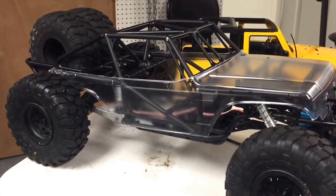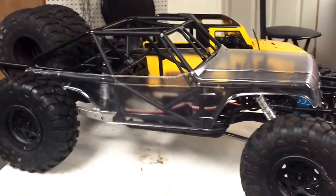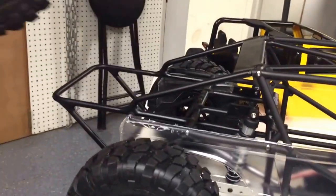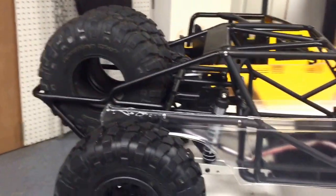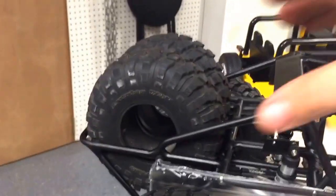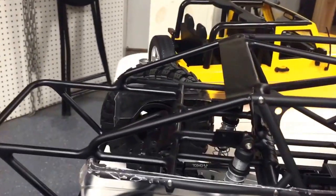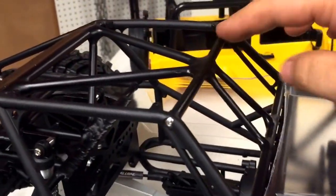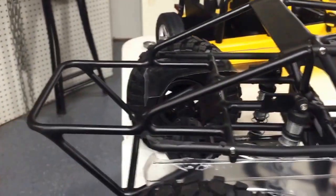All good things as far as why my time is light. But I did want to show you guys what I've been working on, specifically what we've been calling the desert spawn. Now you can see here this long rear back kit. This is a DMG, Death Metal Garage Stiffy Kit. These are all custom, handmade, one-off aluminum. It replaces all the way down the support bars across the bottom of the windshield, comes up all the way back, ties in, and basically cuts off the cage right behind the B-pillar, puts in a new bulkhead, and replaces everything rear of that.